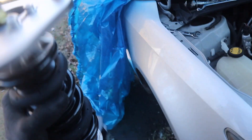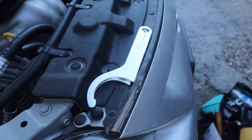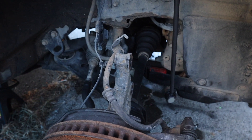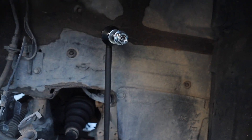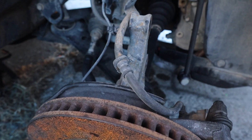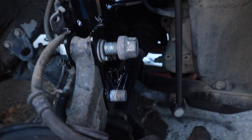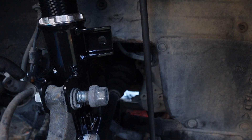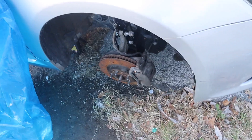Okay guys, we've got our BC Coilover right here. At the top it tells us which one it is, so make sure that you put it on the right one. These are the tools that come with the BC Coilover, so don't worry about that. Before we install anything, we're actually going to put in the bolts — we're not going to put on the sway bar link yet, we're going to do that afterwards. So let's get the bolts in here and get everything strapped up, and then we can jack it up. I managed to put in the bolts — all the other stuff is not on yet. We're going to install the brake line and our ABS. The sway bar link is not actually going to go in yet — we're going to install it up here first, tie it up, lower it down, and then we can put the sway bar link in.